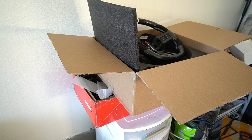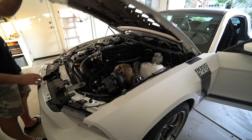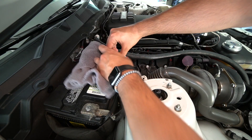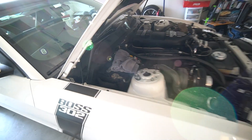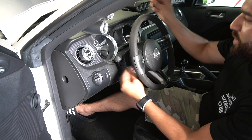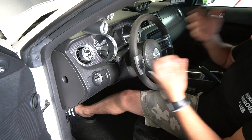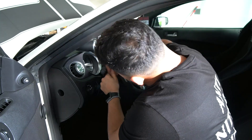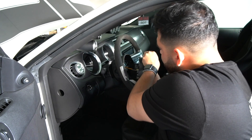We're going to go ahead and get started with the installation of the steering wheel. To do that, the first thing we got to do is disconnect our battery. The battery is disconnected - I like to put a rag just in case the terminal moves around and doesn't end up making a connection again. Now let's move into the interior and start removing the old steering wheel. There are little covers on either side in the back, and you get your wrench and unscrew them. The airbag comes right out - it's pretty easy to remove.